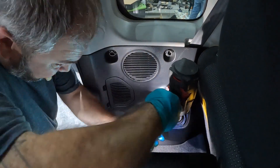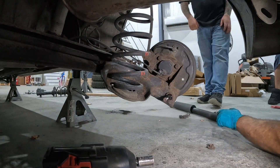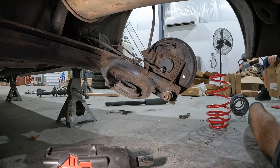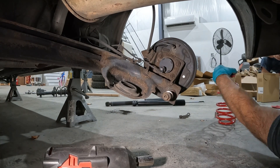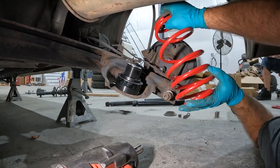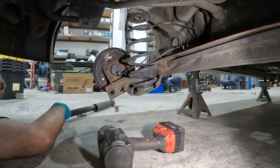It's about an inch lower in the front than it is in the rear. Here we're taking out the rear factory shock — it has double nuts on top so I had to get two wrenches to break them loose. All you gotta do for the rear is take the shocks loose and the swing axle will drop down, then you can pull the stock springs out. I reuse the rubber on top of the factory spring and then bolt the adjuster into the bottom of the swing arm. Then just put the spring back in, and once I did both sides I had one of the guys grab the jack and jack one side of the swing arm up so I could reset the new shock in.